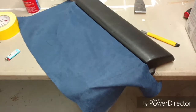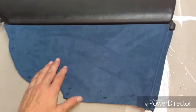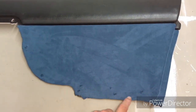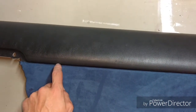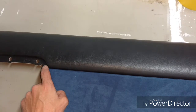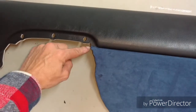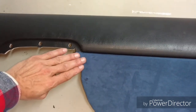Now start pulling and tucking the edge, then cut away all the excess — and there's your finished product. Make sure you've got all your holes marked so you can still go through and reattach the door panel. Take your time on your cut: don't stop and start again, because you could do a bad line. You want one clean cut, starting from the side so you have all of that room.